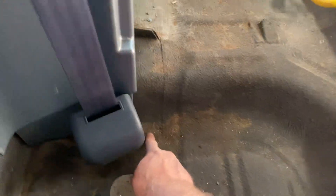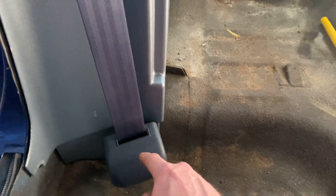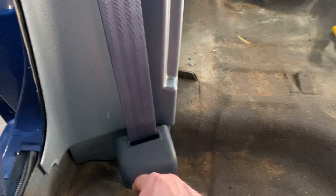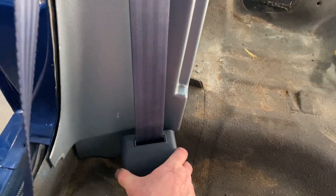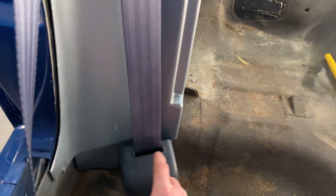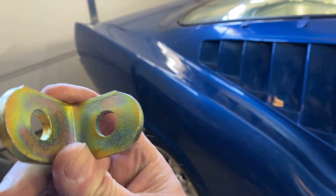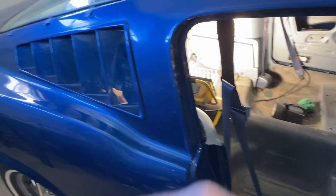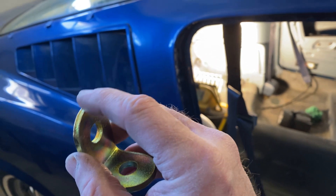Back in here is the rear torque box. The screw that mounts — that I drilled through — actually goes through the rear torque box, so it gives it some extra strength. If you do get in an accident, it's not going to rip out. This is the bracket that mounts the bottom one. There's a long side and a short side. I decided to put the short side down onto the floor and then mounted the retractable on this.